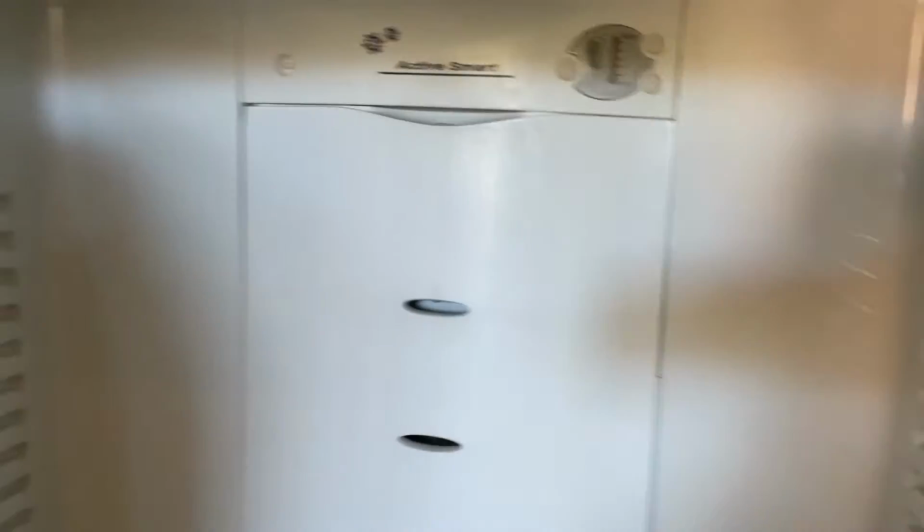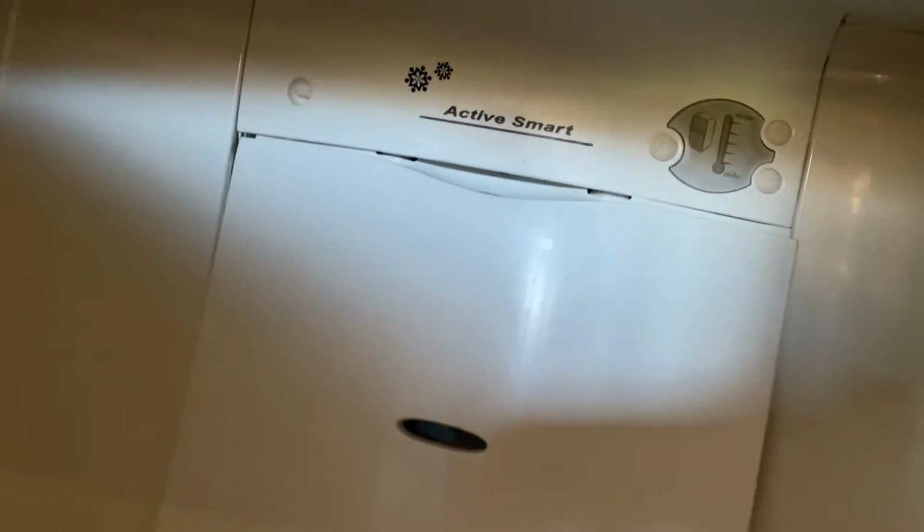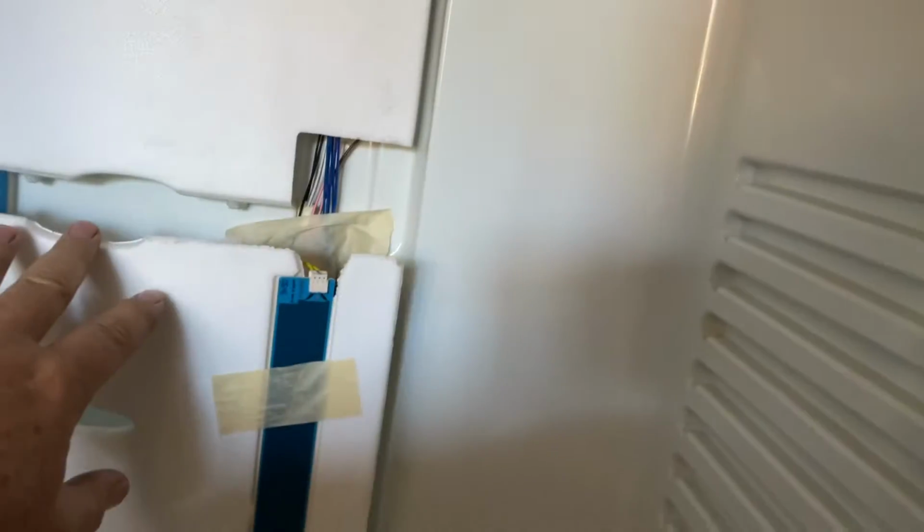So we've moved inside, we've emptied out the entire fridge and we've turned it off. And then in this Fisher and Paykel, you can see the finger holes here, top and bottom. We've just levered that out, and that panel, you can see it's dropping down at the top there. Here we go, that panel comes out, and then there's insulating foam in behind. You can see this one's connected to probably some sensors, temperature sensing things. It comes out, be very careful of those. We can unplug that if necessary.